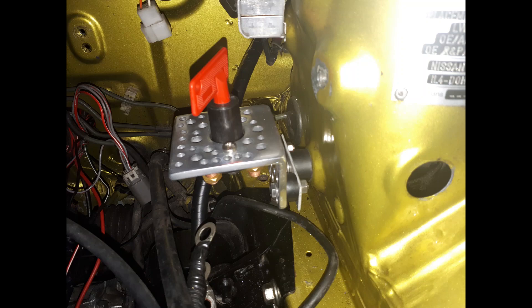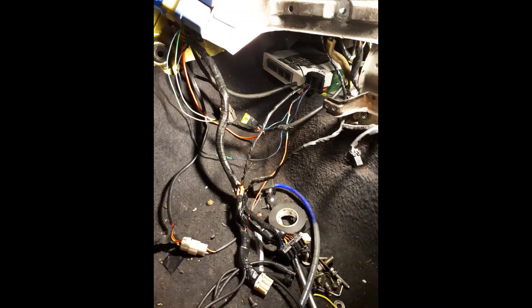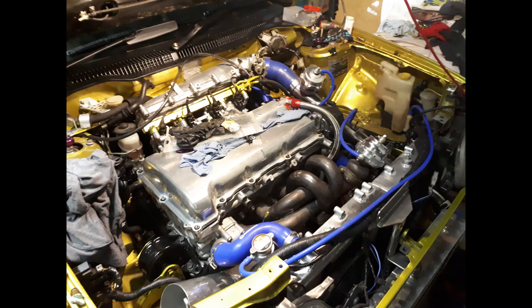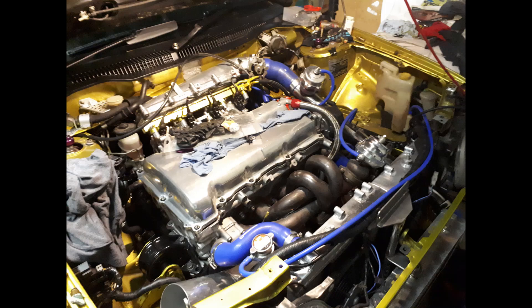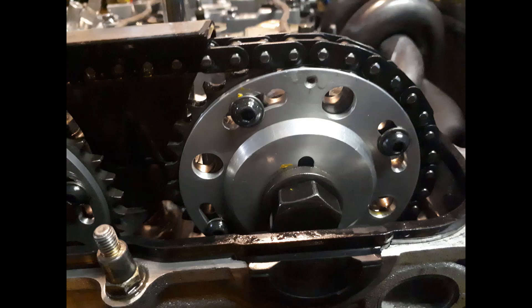I also put a stock factory seat back in the front and fitted a new steering wheel. I then pressure-tested the whole system and found the RB25DET throttle body had a major leak out the side of it. I bought three more off Trade Me and they all had that same leak. I could have bought a rebuild kit for them, but at that point I'd just had enough of it and decided I'd replace it with a larger throttle body and just get it going as-is.